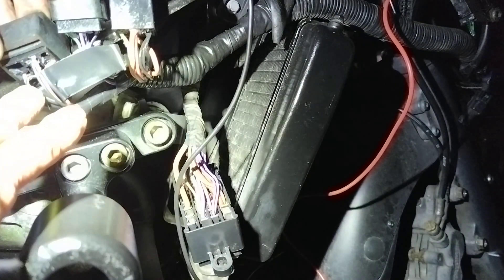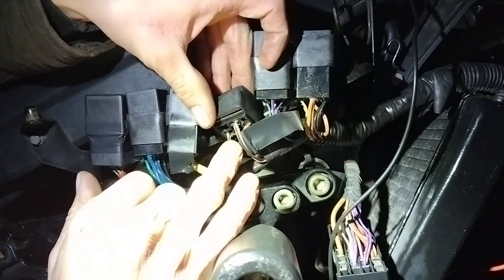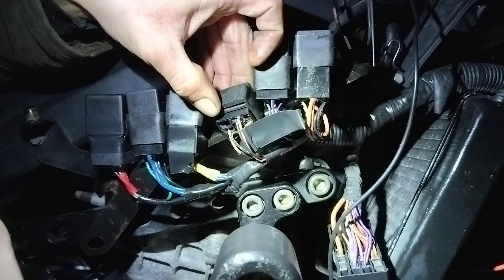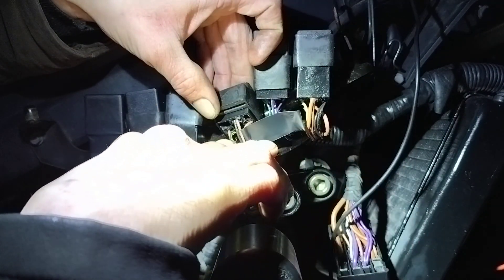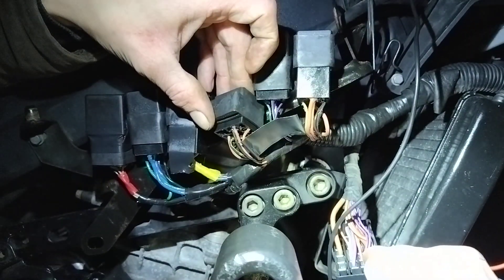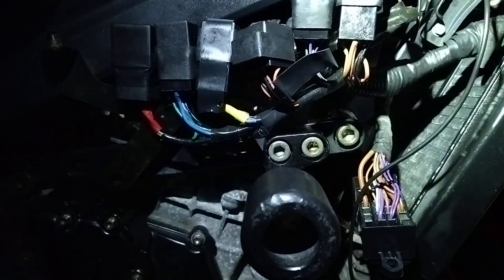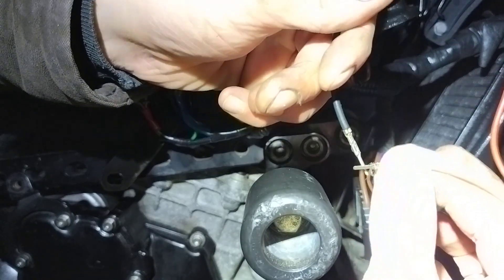You've got a black and yellow wire here, and that's coming from your ECU. There'll be a signal — power from the ECU — sent to complete the relay switch to allow the power to come through the other side, essentially to ground. These are the two wires, so you want to identify which one is which first, because obviously one is going straight from your fuse block down to here. The easy way to do that is with a multimeter continuity test.